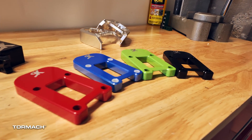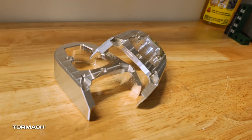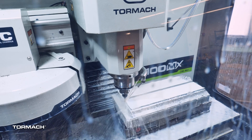These are bash guards, so they protect the front and back of your board from damage. We actually powder coat them here in-house. These are some skid plates that help protect your belts as well as your motors from damage as you're riding around. We CNC them from 6061 aluminum, all billet, and we also make them in-house.